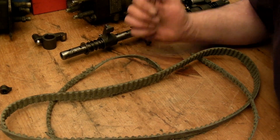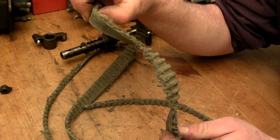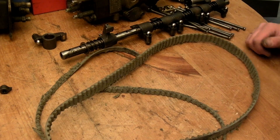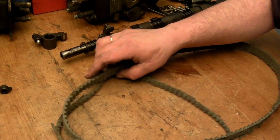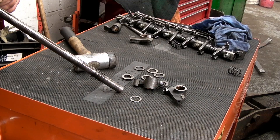The timing belt I've got here and am demonstrating didn't snap — it was shredded, and you can see there's actually mud contamination. This is due to the fact that the drain plug was left out completely when the vehicle was off-roaded and waded, so filthy water and mud got in and made the belt slip. The shredding happened because it was caught up as the crank was still revolving.